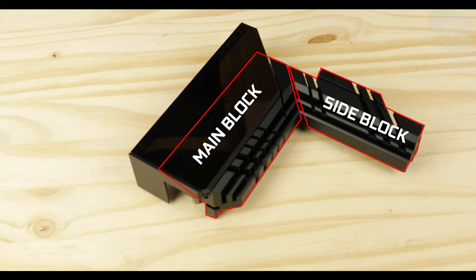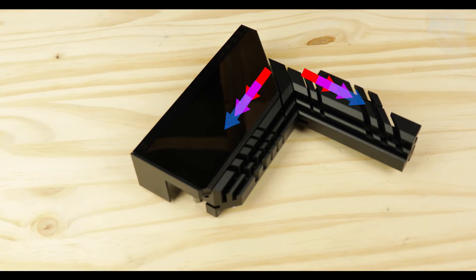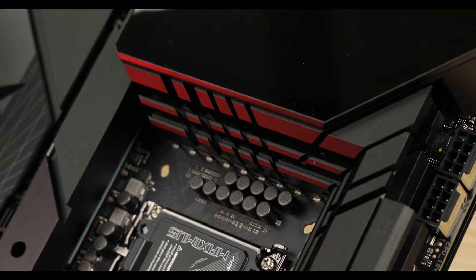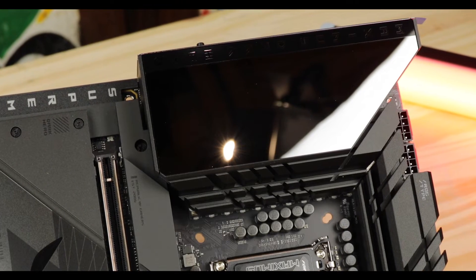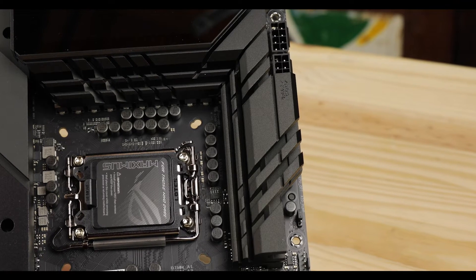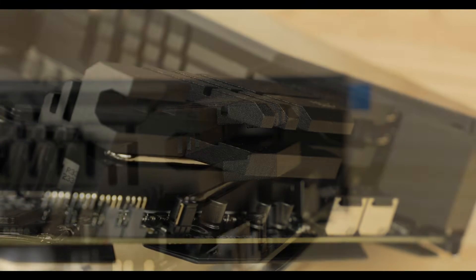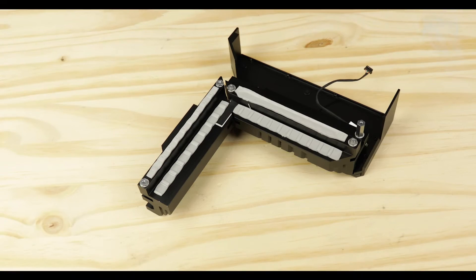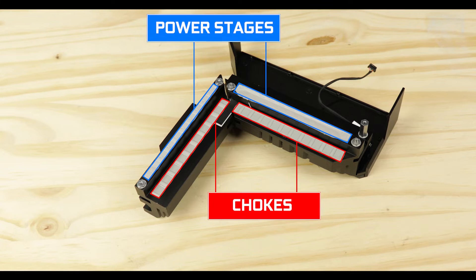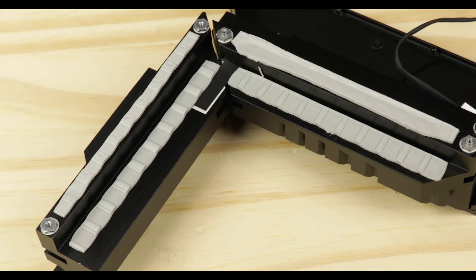Cooling-wise, nothing but the best. We have a very large two-VRM-block design linked by an 8mm copper heat pipe to ensure homogeneous heat spreading. The main block is a four-stage monster of sanded aluminium topped by a rather large radiating plate. The side block is a very good-looking, thick two-level chunk of metal that not only does a great job keeping temps at bay but looks like an artifact from the movie Alien — which I love. Both blocks feature a double-contact design ensuring direct, intimate thermal-padded contact to both chokes and power stages alike.